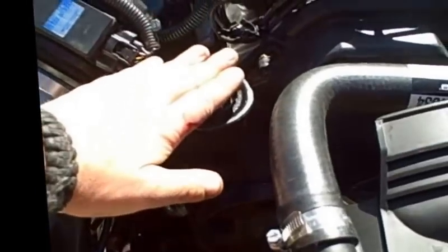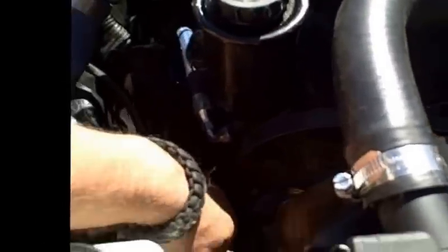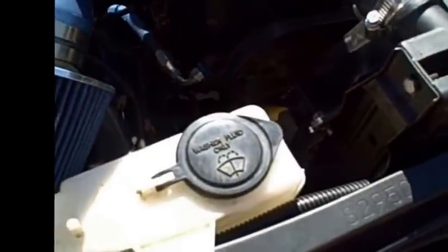The other thing you're going to need for your 3.4 power steering pump is a high pressure line, because the unions on the 3.4 and the 3.0 down there really won't match up. So what I opted to do is get a high-pressure hose from Off-Road Solutions. Yes, it was kind of spendy, but it's kind of needed in the process.